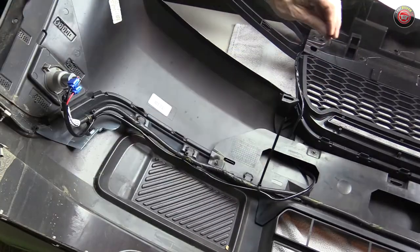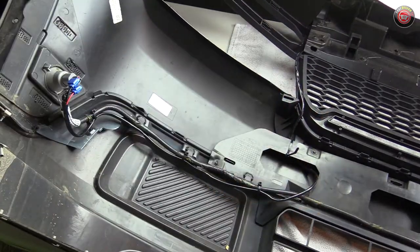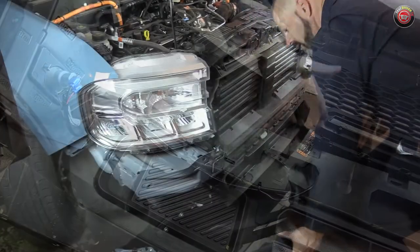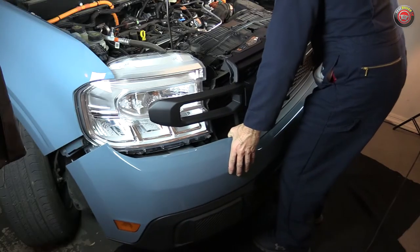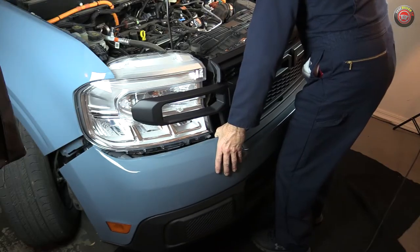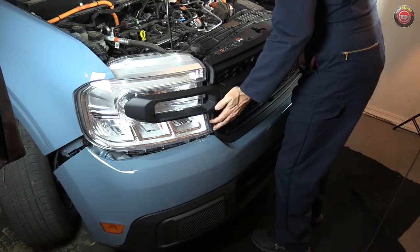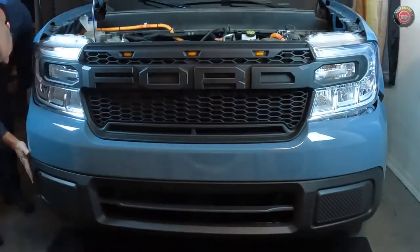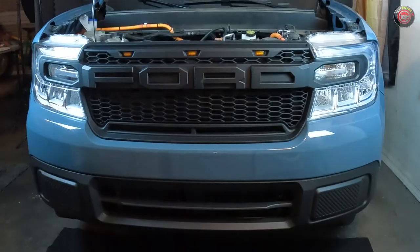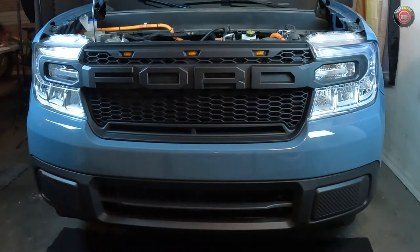The final job is securing and making pretty the installation of the wiring harness in parallel alignment with the factory one using zip ties. I just love a neat wiring harness — whether it's perfect or not, it will certainly not be seen hanging behind the grille from the front of the truck; completely hidden. Now the reinstallation of the entire assembly begins. For the most part, it's all about repeating every step of disassembly in exact reverse. The first thing I did, however, was hang it in place at the top with the two alignment tabs and then plug it in and test it before installing a single screw or clip. This is a good thing, as the first time it didn't light up and I had to redo one of my splices — I'm glad I found that before spending an hour or two bolting the whole thing back up. You'll be wise to take this 30-second test as well.